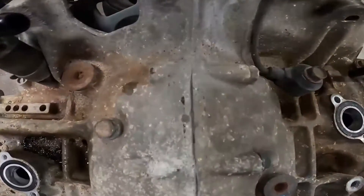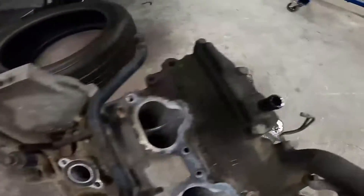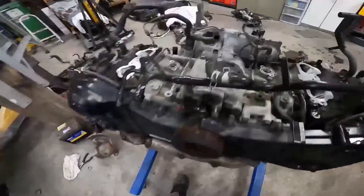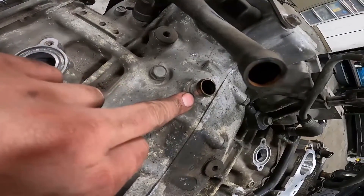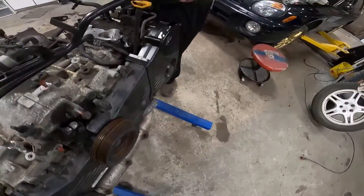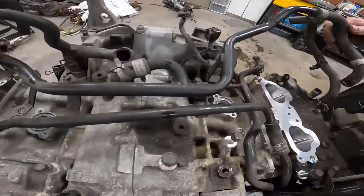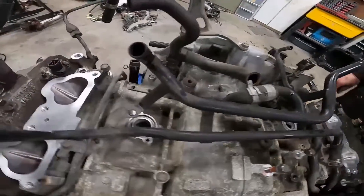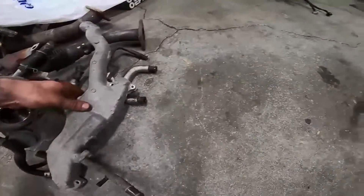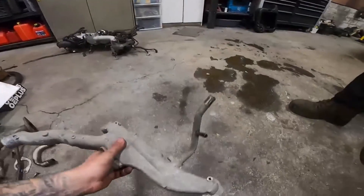Another difference is this one doesn't have a crank vent in the middle of the block and only has single breathers on the cylinder heads. The JDM has a second breather on the engine block and two breathers on each side of the cylinder heads. To overcome that we're using the JDM routing for those, so they'll all plumb back into where the USDM would have been, and we use our domestic coolant crossover - always do new O-rings or you're going to regret it.